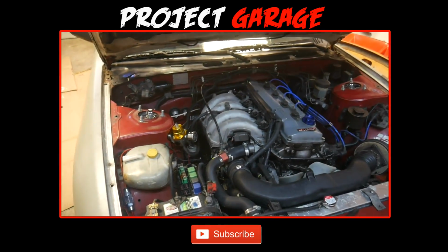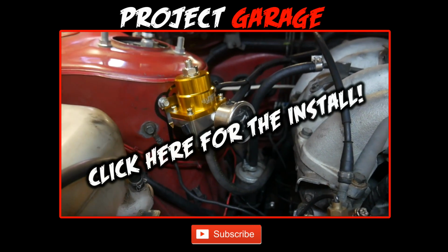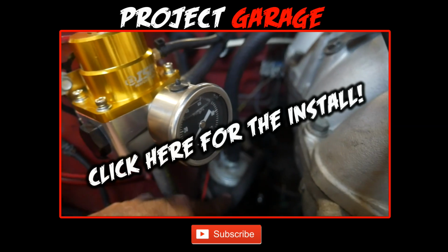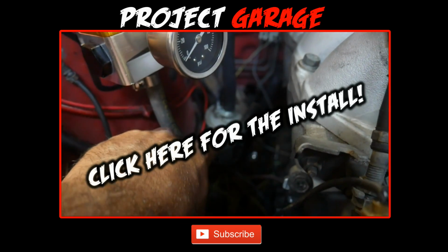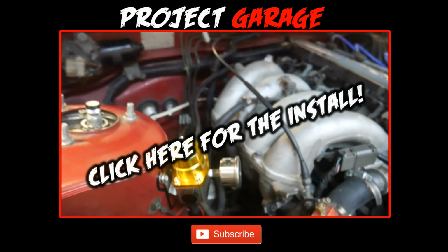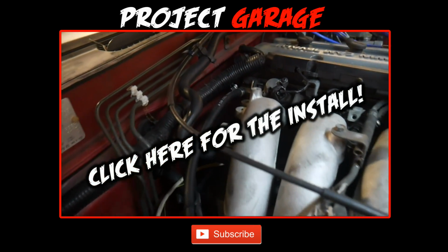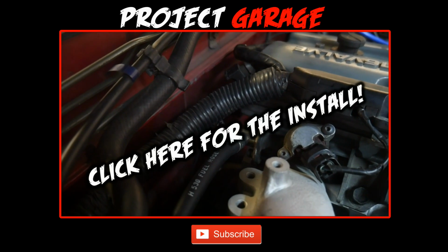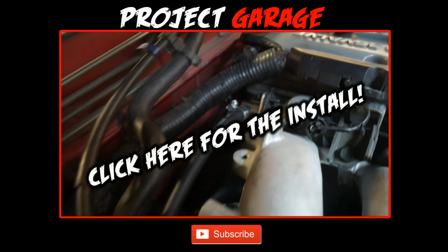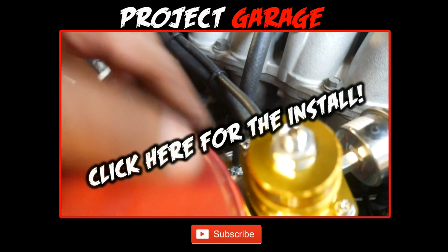Alright, so here it is, installed. Looks not bad actually. Here is our return line, and this is going down to the factory fuel return line on the chassis. If you go over here, we've got our fuel in, which is coming from our fuel pressure regulator, which is coming from our fuel rail adapter, and that's coming on a fuel injection hose into our side port.